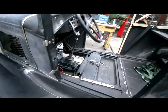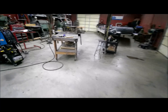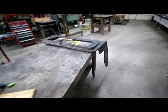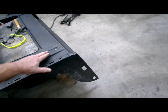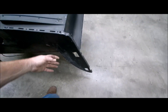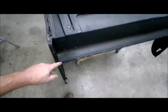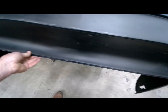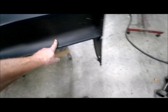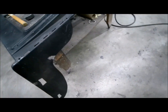And while I was doing the seat, one thing led to another. And then now I've got the seat frame over here. I've got it upside down now, but I've had to weld and straighten it here. This was all bent up, welded here, straightened the sides. I've still got some straightening to do here. This lip was off, beat all the pieces where all the nails were in that bottom piece of wood, and I've got it straight. I'm working on the dolly and all this now. Welded here, straightened it here, welded here.